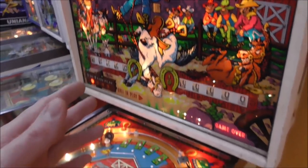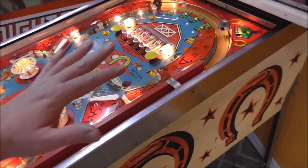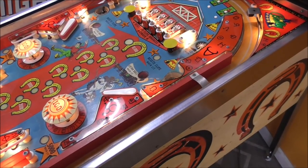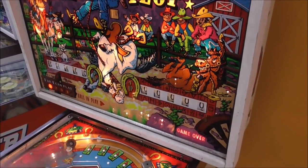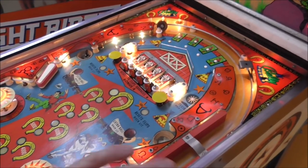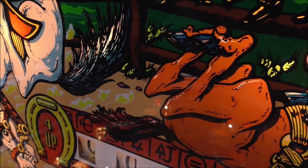But if you know anything about silk screening, basically you lay the glass down and then you have a screen, like a screen door, that goes over it that you kind of squeegee paint on. They may have had a machine that did that automated. But each screen, you had to have a screen for each color. So you would lay down a clear piece of glass. And then in this one, they probably silked the black lines on first, because they're on top of everything. So they did a black one, right? They let that dry. And then maybe they did a brown one, right?